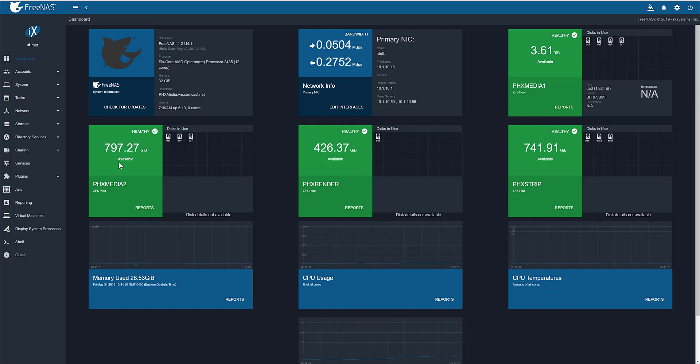This pool here was degrading, so I had to put another drive in. When I did that, everything went fine — resilvering went fine. Then a day after that, the USB key died. Because usually when you do a FreeNAS install, it's installed onto a USB key. Well, the USB key died.